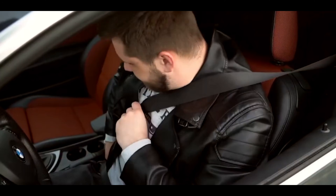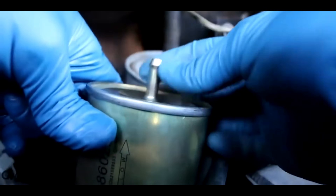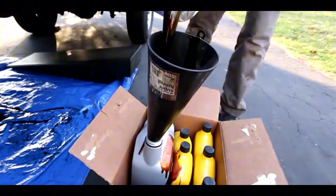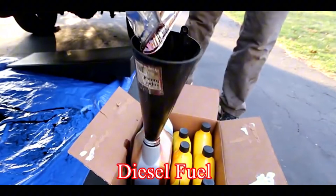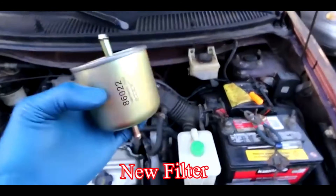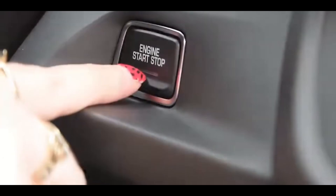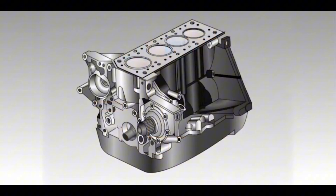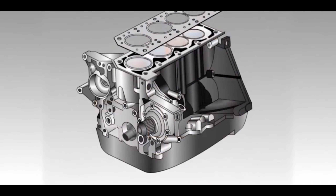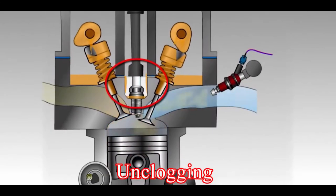Once the engine is nice and hot, shut it off and get ready to replace the fuel filter. Simply twist off the fuel filter housing cover and remove the old filter. Once the old filter is out, drain or siphon any remaining fuel from the housing. Here's a neat trick: instead of priming the empty housing with diesel fuel, fill it up with Sea Foam and then install the new filter. Now start the engine and let it idle for two minutes or more — but not too long. During this time the engine will be running purely on Sea Foam, giving those injectors and chamber components a good soak, thereby cleaning and unclogging the fuel injector.